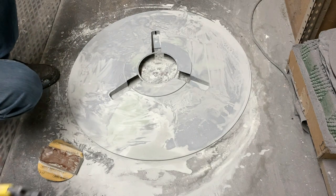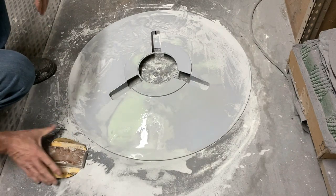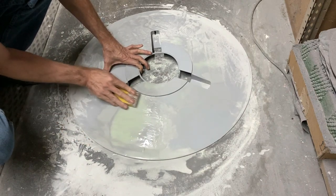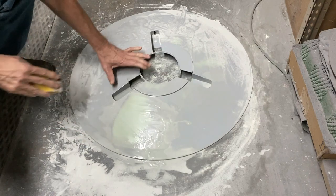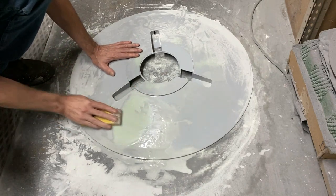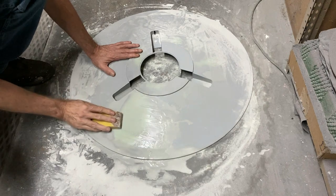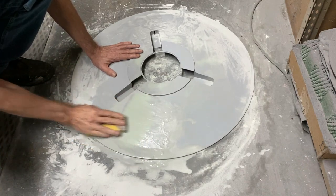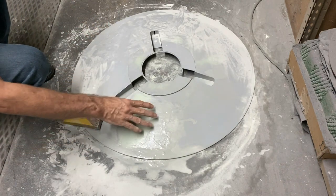So that's what I'm working on right now. I'll just show you — I'm using some water here, getting this nice and soaked down, and then I'm just using my block with a 180 grit paper. I'm doing some hard manual sanding, going back and forth in a nice smooth motion, and I can feel it with my hand and fingers. We'll just keep working that down until our edges here feather out and smooth out really nice.